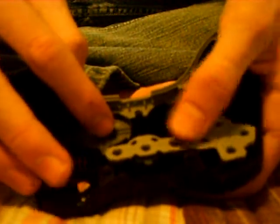What you do is, you put the bottom piece in first, in the back, and then you put the D-pad in, and there's like these 2 big little holes. They go into the slots inside the D-pad, and you just push, and it goes right in. And next, you simply put the screws in. Use your screwdriver, the small plus one, and you simply just screw it in.